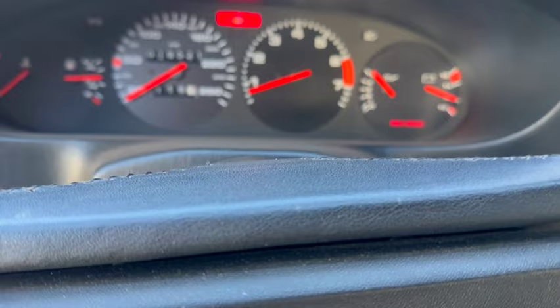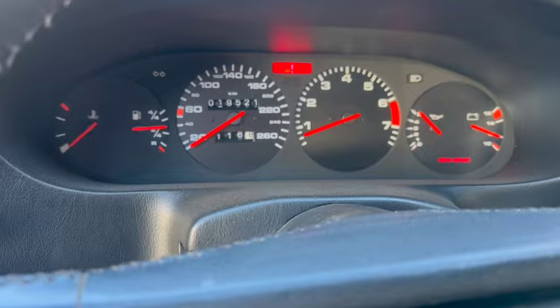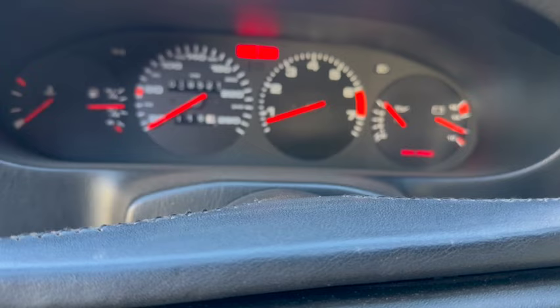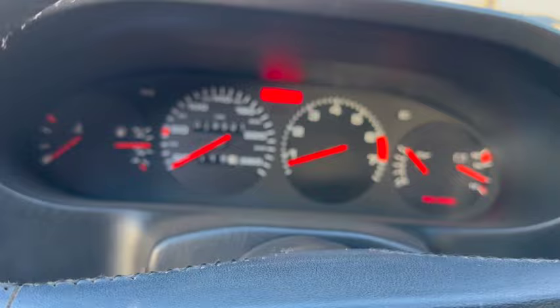It's been idling for about two minutes now and we're starting to see just a tiny bit of heat in the engine. The RPMs have fallen to about 700, and we're still pegged at five bar of oil pressure. When we get going, the oil pressure will fall — when fully warm it'll be down to about two bar. The engine temperature behaves itself, sitting rock steady about halfway through the dial once it warms up.